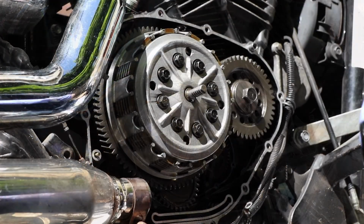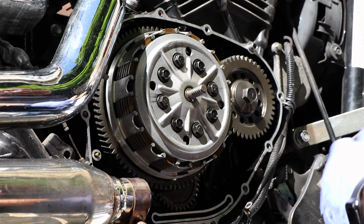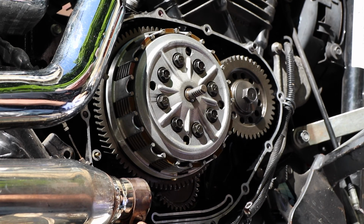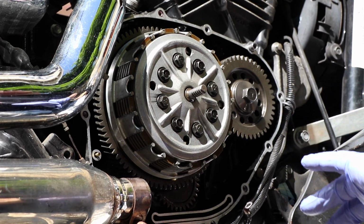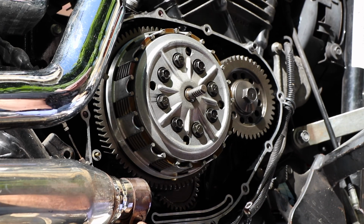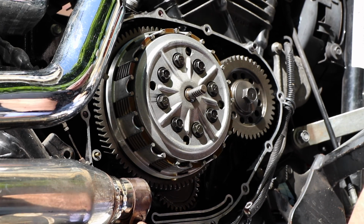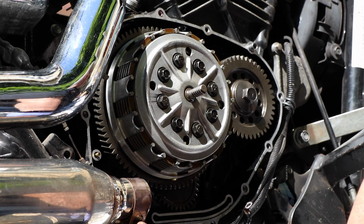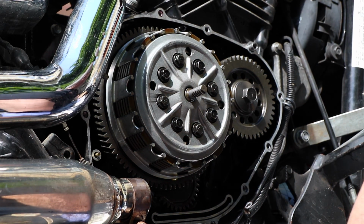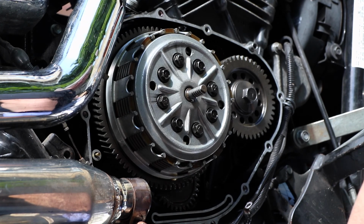All right. Clutch bolts, long bolts, short bolts. You remove the clutch bolts diagonally is what they say, and remove the clutch plates. That's on 3-17. They also refer to a tool known as a rotor holder, which you absolutely do not need to use to do this job. Somewhere, I guess on the clutch reinstallation, which is page 3-54, we're going to go to that service manual next.